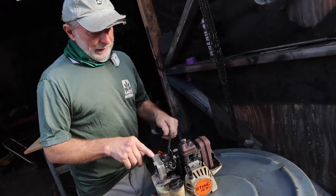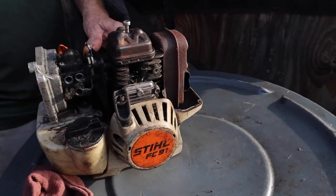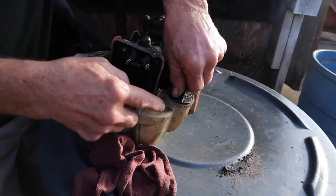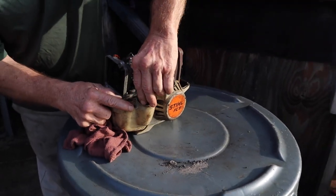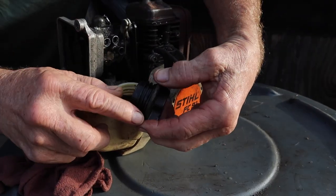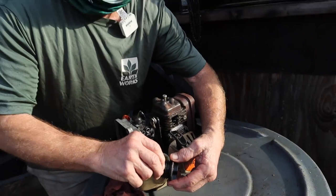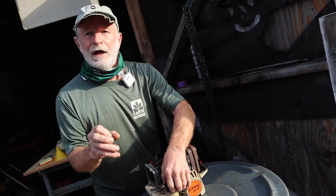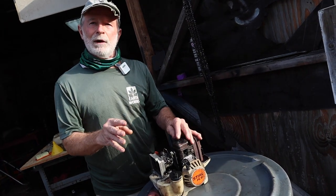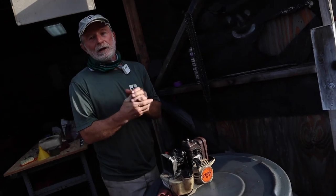This is what we call a weed eater engine. As you can tell, a lot of dirt has accumulated around this thing — this is why the importance of an air filter is so high. As we said earlier, before you take the filter off you should wipe the area down first. All these threads are covered in dirt, and even though they have a good filter in there, it can only do so much. A little bit of extra time and attention to cleanliness makes your equipment run a lot longer with a lot fewer problems.